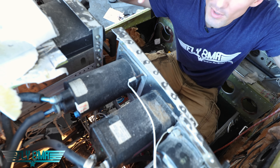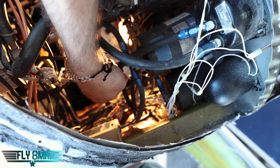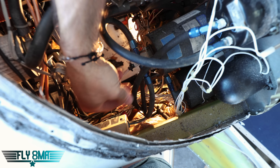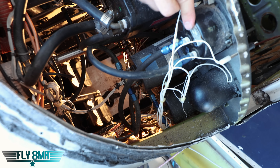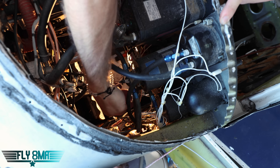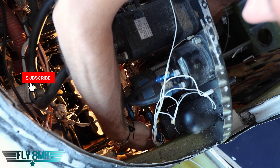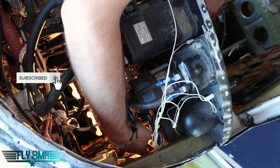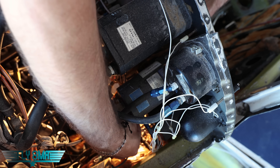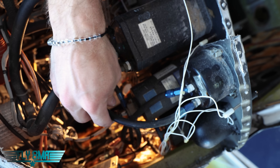There is no windscreen — obviously this is the backside of our panel. We can see where our pitot and static lines come up from the bottom. This is your pitot line right here, flowing right into the airspeed indicator. We also have static pressure going into the airspeed indicator, and that static line flows down all the way past the firewall. The first instrument it hits as it comes along the sidewall just after the firewall is actually our VSI. Then it flows over through a T-fitting into our altimeter, and lastly makes its way up into our airspeed indicator.